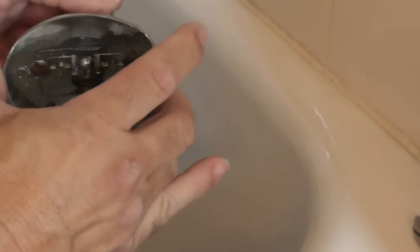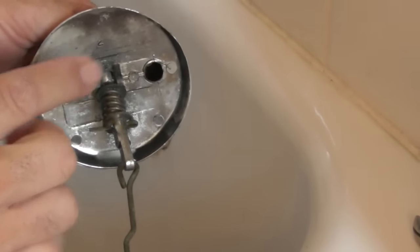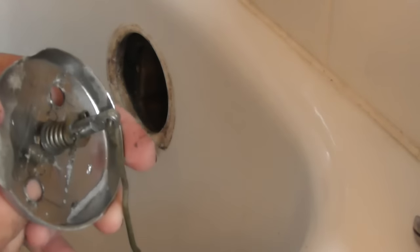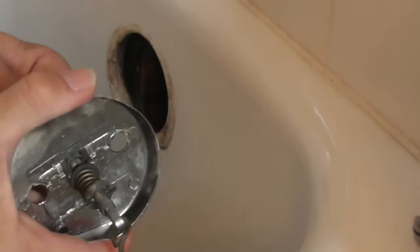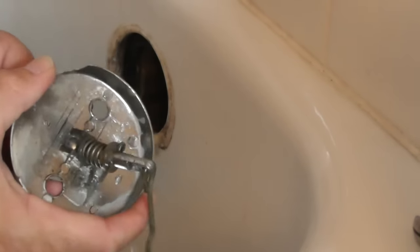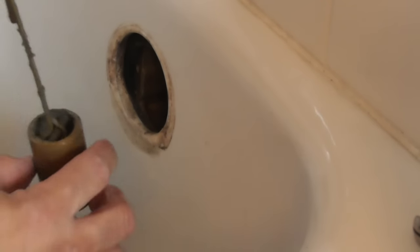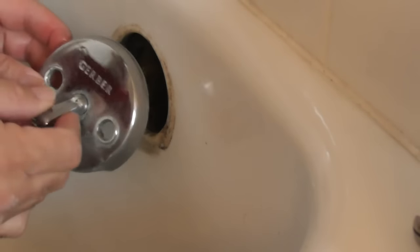Let's see if it made a difference. It's a lot — it's starting to break loose now. The ball joint in there was gunked up. Let's get a little bit more of this spray in there. There it is — fixed. It's not binding. This is probably 25 years old, but I fixed it enough that it's good. The spring is kind of catching but I'm not going to tear this thing apart, I just want to make it easier. This ball — this thing is clean, so I'm just going to put this back in the hole after lubricating, and just let it drop back in place.